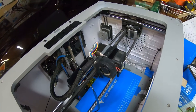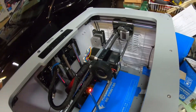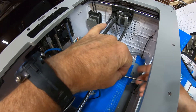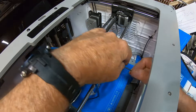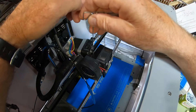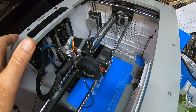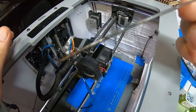The first thing we're going to do is clean out this print head as much as we can. We're going to unscrew the fan screws in front. I've shown this before but I want to do the whole procedure as one video. The main thing I'm looking for is reliability of printing — because I'm trying to sell stuff, if a print fails it's a big deal. I push the push rod down to the bottom and spin it, and that will get some of the filament to stick to it. Use the tweezers again to grab anything that pushed out on the bottom. When you pull it out you see some filament is stuck — you have to quickly scrape it off.